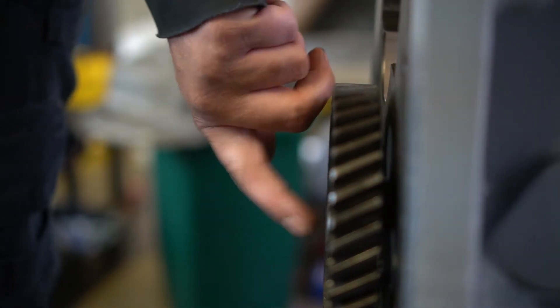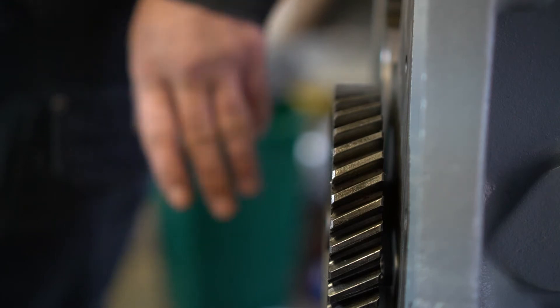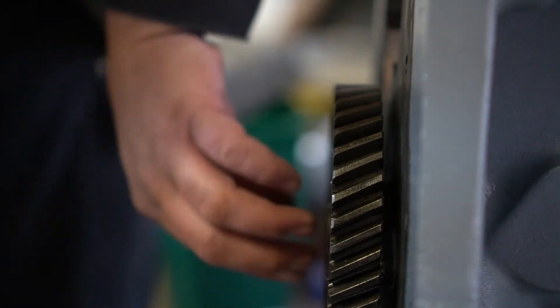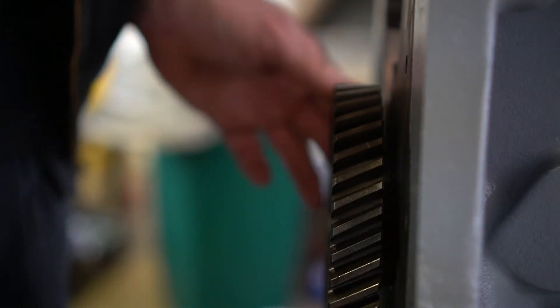We'll probably leave that. If you need to change this thrust plate, there's a snap ring right here on the front of your gear, and then you have to press this gear off of the camshaft. That plate just slides on, then you press your gear back on and put your snap ring on to secure it. They're not too difficult to change if you have to. I know mine sounds rough — that's because there's no oil in it, this was just a dry test fit. It's okay on spec, I think.